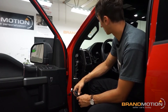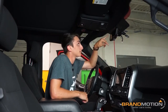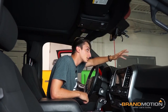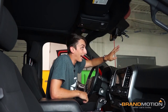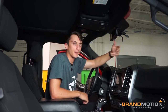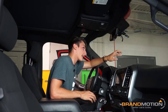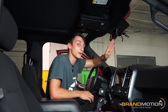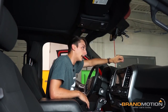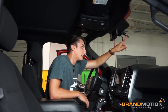I've gone ahead and ran the power harness for the ADAS coming from up in the headliner, so it's waiting there. As far as mounting location, I prefer to mount it dead center right below the mirror — almost hide it behind the mirror. If you do want to see the ADAS screen, you can mount it left or right. The calibration system will call out left or right, and I went ahead and mounted mine dead center just below the mirror mount.